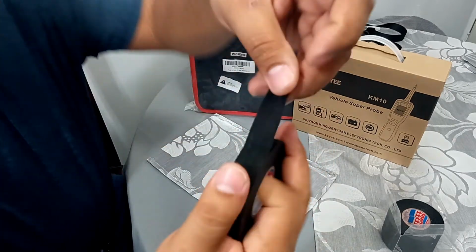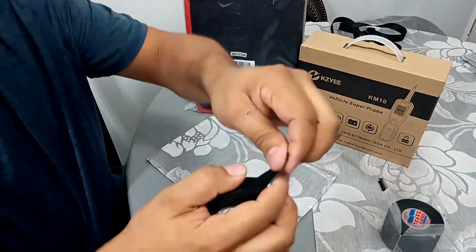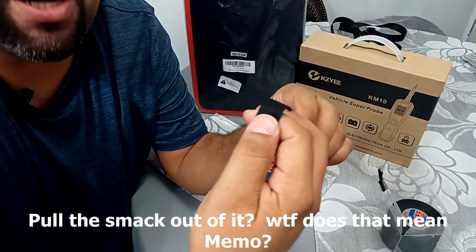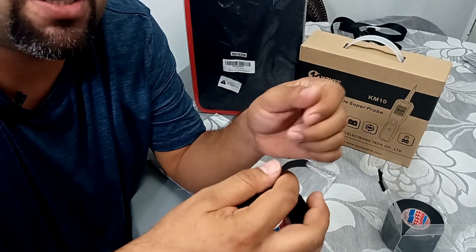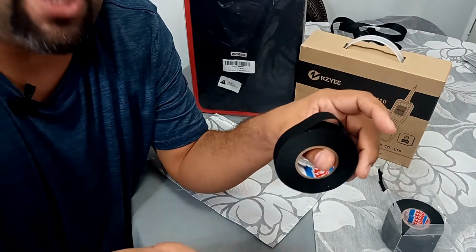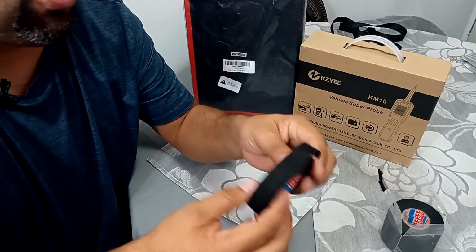So you see here how there's cloth lining it, and it's hard to stretch, and it rather breaks before it stretches, so there's no stretchiness to it. You have to pull really hard on it in order to rip it. Whereas electrical tape, it just stretches and tears right up. And so that elasticity on electrical tape is good in some applications, bad on others. As soon as heat gets to that electrical tape, usually it starts getting all sticky and it stretches more and it loses its capability to hold the wire loom together.